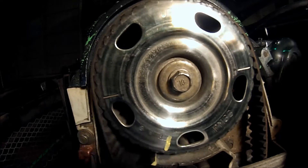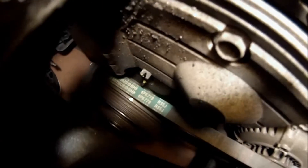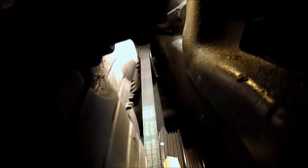You're going to want to do the same thing to the crank pulley. The crank pulley has a mark on it also — it's the single mark. There's three marks off to the left: one, two, three. The middle one is for ignition timing; that's about where you want it to be set.